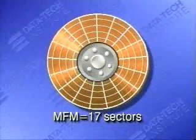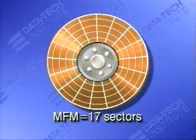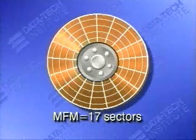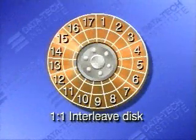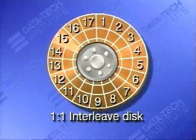Recall that each track on most hard disks is divided up into 17 sectors. We'll use MFM for the example here. Each sector holds a mere 1/2 K bytes, not a lot of space. As a result, when we need 1 sector on a disk, we usually end up needing all 17 sectors. So we need to arrange these sectors so they can be read in order in the smallest number of rotations on the disk. Now it seems that this arrangement is the fastest, so all 17 sectors get sucked up on the first pass. Unfortunately, it's usually not that easy.